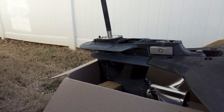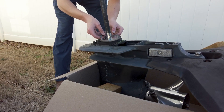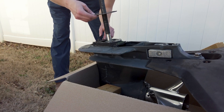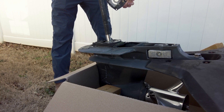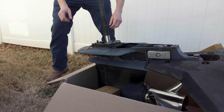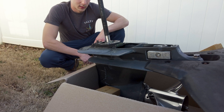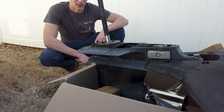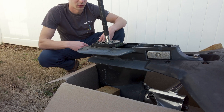Take the rest of this apart. Now it looks like the metal plate — so you got the gasket and the metal plate, we'll just lift it off as one. And it looks like the lower gasket — oh okay, it's on here. The gasket actually came off, so I don't have to do that much cleaning. My next steps are to clean this off and redo the gasket maker on the back, but I'll do that last. I'm gonna have to get it off first, then reinstall the new water pump and we should be good to go.